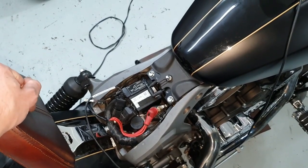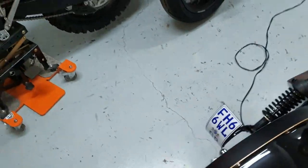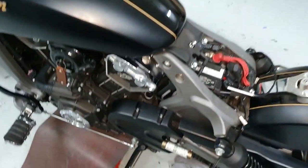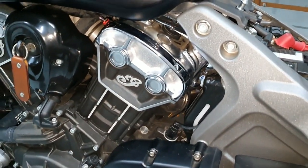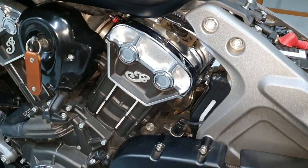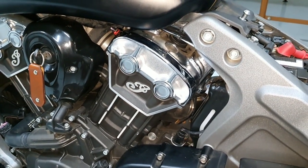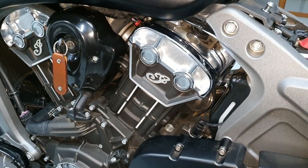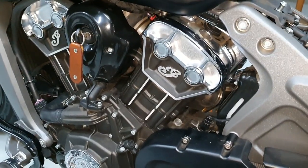It's okay, but it will need replacement. It's one of the old ones, not an AGM, not a gel, it's the OEM. And after 5 years, I'm surprised it still turns, to a certain degree. Next battery will definitely have more cold cranking amps, CCA. This thing needs about 220, so if we go 240, 260, should work. Although lithium ion would be better for such a big V-twin. What else have I done?